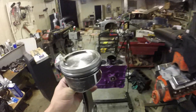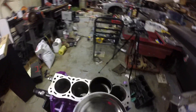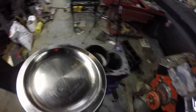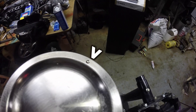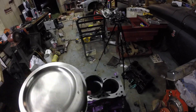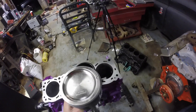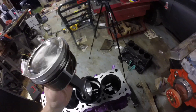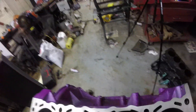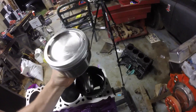Basically we're going to set this piston into the piston ring compressor, but when we do this we want this little dot right here on the piston — you want that little dot to be facing the front of the KA, the front of the engine, which is this way. I'll drop it in like that. This is number one, so when I do number one it goes right here with the dot facing forward. Let's get started.